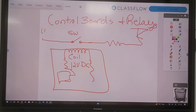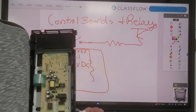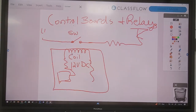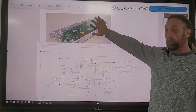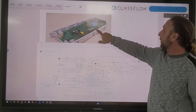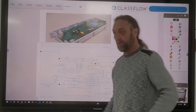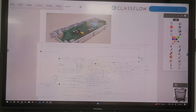Let's take a look at the diagram. We're also going to compare some of the similarities to this microwave board and show you how, if you can understand how some of these parts work when it comes to troubleshooting, then you would know whether the board's good or bad. If we look at this page here, we have the same board I just showed you. You've got a relay here, a relay here, a relay there, and some external plugs here for the harness of the machine.